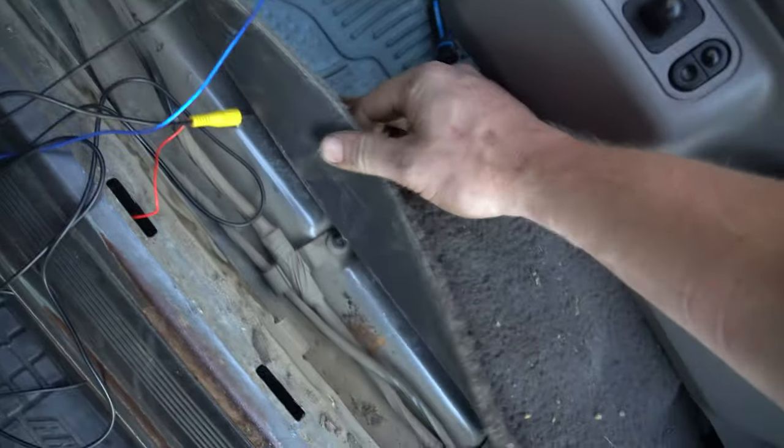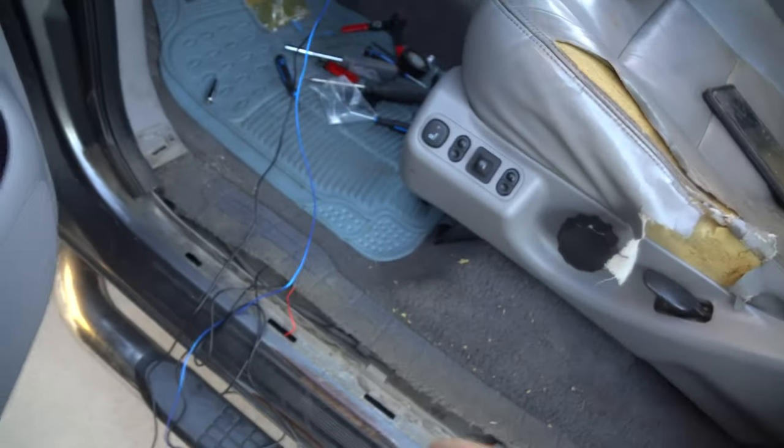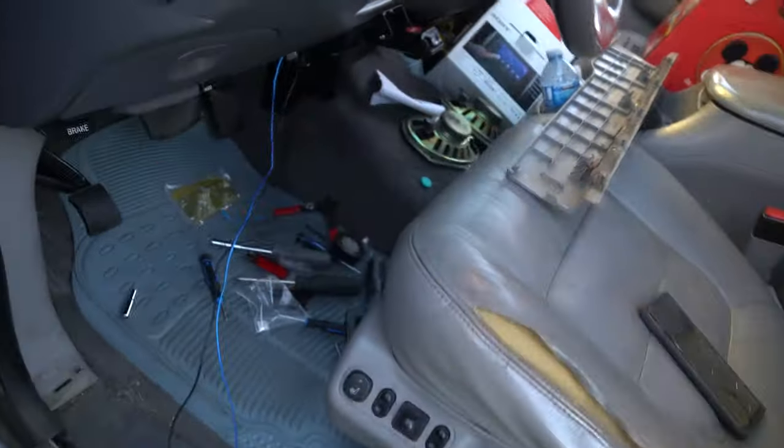We'll remove this and disconnect it here. What we're looking for is a rubber plug — there's usually a rubber plug that goes under these carpets so that if you ever get a flood or anything you can empty it out. What we do is look for that rubber plug and shoot our wire down through it so it goes below the vehicle. You can also do it by going under the vehicle and taking a quick look, but usually it's in this footwell. If you have a floor mat, take it out, pop this out, and there's the plug.